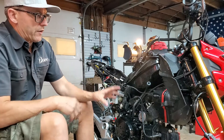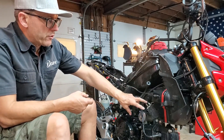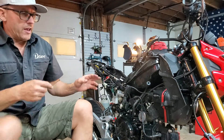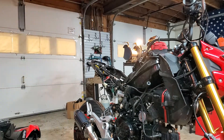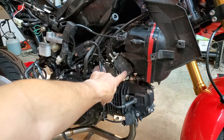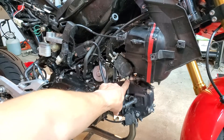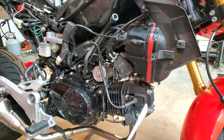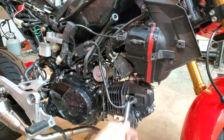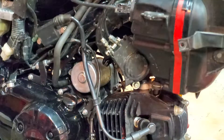To really adjust the idle, you have to come over here to this side where the throttle cables come in to the throttle body. Very simple — right behind this cover right here. Get your wrench and take this guy off right here. Eight millimeter. Take this eight off here and we'll show you what's behind this cover with a closeup.